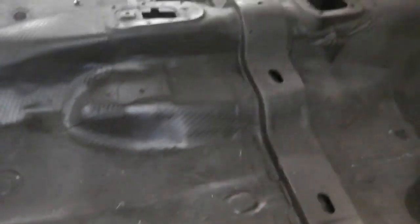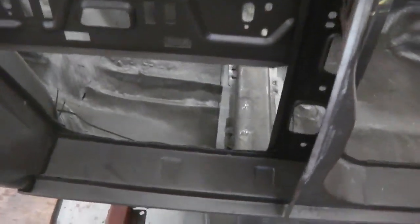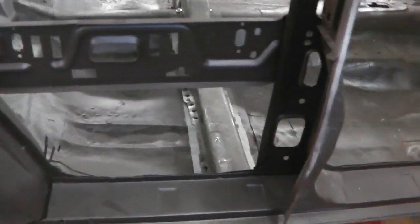And obviously, as soon as that's in, you get yourself another square of strength right in the middle of the car there that's formed, a nice bracing operation performed across the car up this end. So more rigidity into the shell as soon as we fix that fork and that cross member. And then that takes us right into the corner to do the leg extensions for the boot floor.